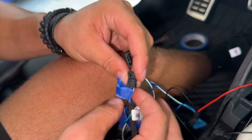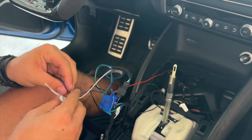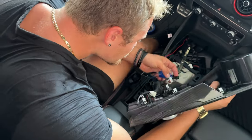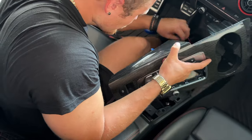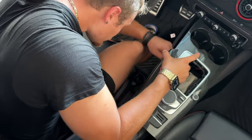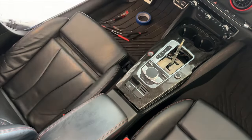I'm just going to tape off the two wires but everything should be good to go and wired in correctly. With the harness officially plugged in it's time to reassemble the center console — put the little black clip back on top of the connector and plug all the wires back into where they came from. Slide the center console back on and test the push start before putting everything fully back together.